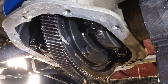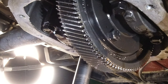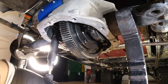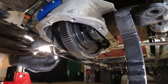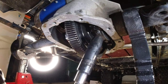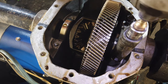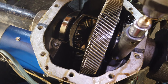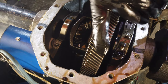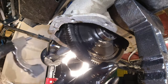I'm going to take an impact wrench and take these bolts out to get this lower end of the differential out. Note that you have to pull those two shafts out before you can pull out this big gear in this part of the differential, because if you don't it won't just slide out the bottom - you definitely have to get the two axles out first. Take these four bolts out with their holders, and once you get down to the last bolt you can start sliding it back and forth just a little bit, and you'll eventually get it loosened to where you can just grab the gear. It is fairly heavy, and if you don't take the whole transaxle out of the golf cart and flip it upside down, you're going to need some extra help to hold this gear as you unscrew it.